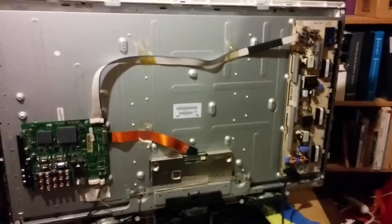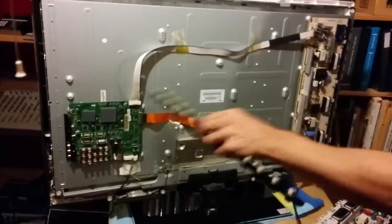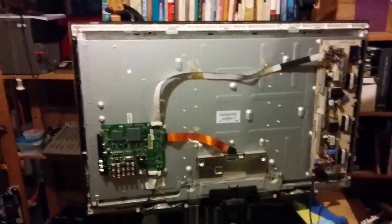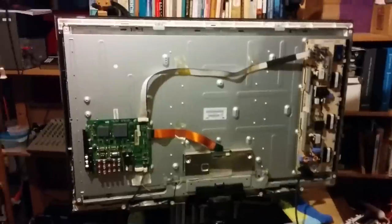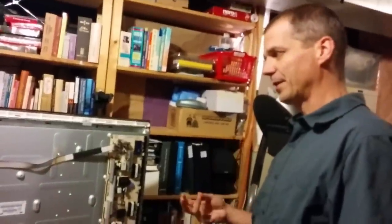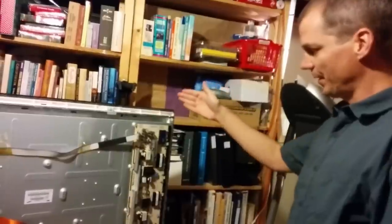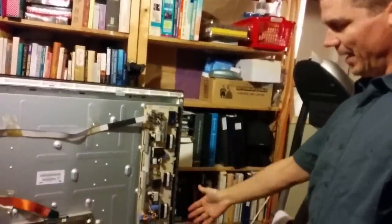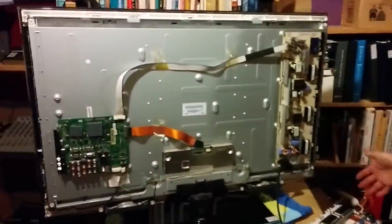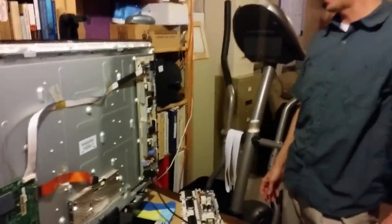Now, as I said earlier in the introduction, there are tubes that we're going to see soon that traverse across this entire TV, quite a few of these tubes. And over time, from what I understand, they age, and they can start to become more conductive. And that conductivity increase might increase the amount of current that this high voltage inverter system is supplying, and it might be shutting down. Hoping it's shutting down because of that.